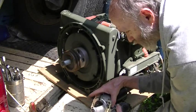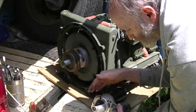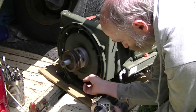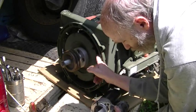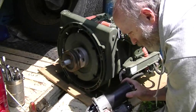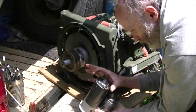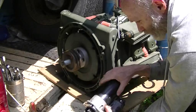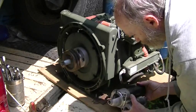The idea is this is a planetary gear type starter — planetary gears in here, it's geared down. The mesh of this starter has to match the gear: the ring gear on here has to fit into this. This starter just happens to work perfect. The diameter is the biggest problem — trying to find another starter, the diameter of the starter will not fit in here.